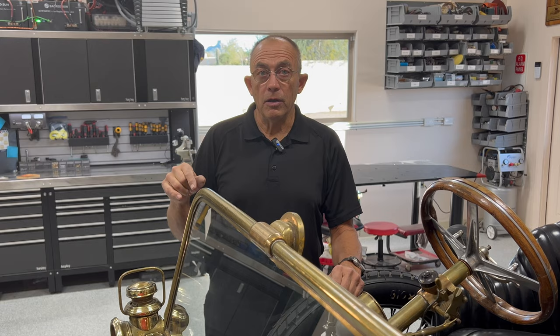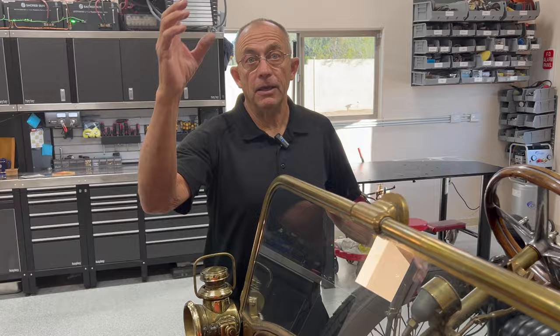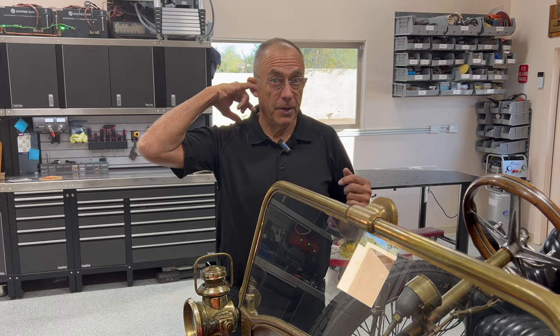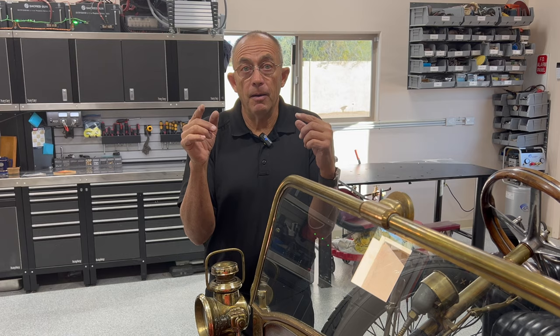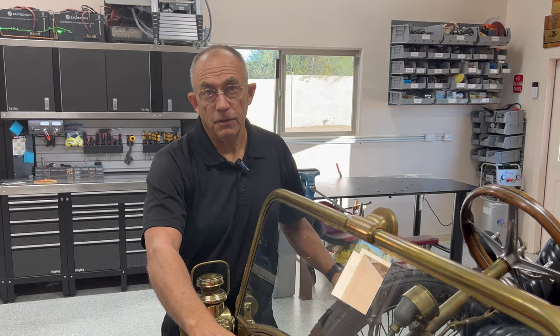The pan of the engine is below the bottom dippers on the crankshaft — it's an extended pan, it's a dry sump race car. The only oil the engine sees is the oil that comes from the pan, back through the pump, into the dry sump tank, and then is fed back into the main bearings and into the troughs that the dippers on the rods pull from. It does have an oil pump, but when you start this engine dry there's no oil circulating.